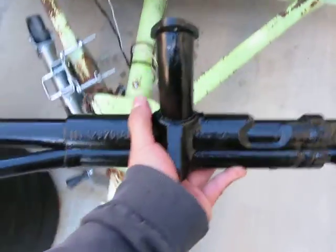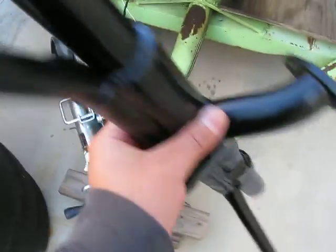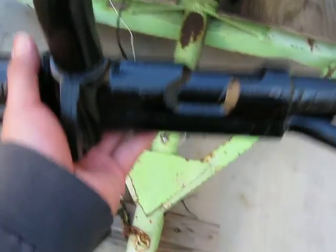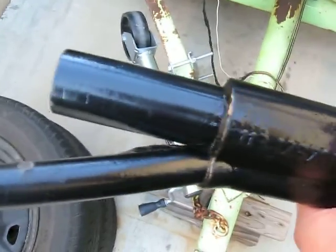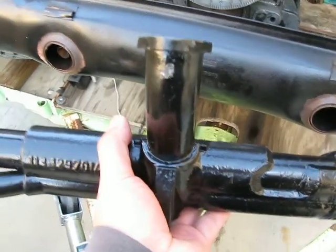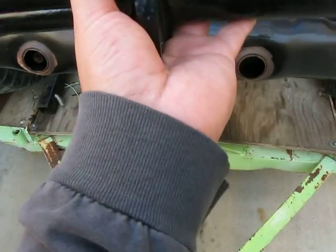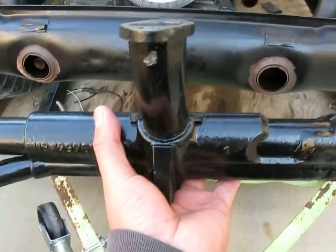It wasn't until I came to mount the carburetor onto the manifold that I had a problem. I know in Europe they made 1300cc dual port engines, and I'm assuming this manifold is for that — because it doesn't look like a modified single port manifold shortened to fit a 1600cc dual port. So my question is: even though the heat riser tubes mount in the right spot, if I clamp the intake manifold boots tight and put this on my 1600cc dual port engine with a modern replacement H30/31 carburetor, will it work? I'm pretty sure it would, as long as I have the right jetting.